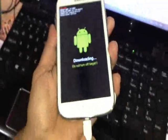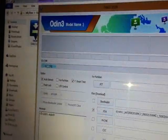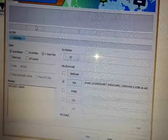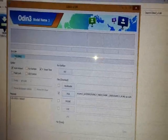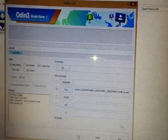Now you need to connect your phone using the data cable to your PC. Once it's connected, you will see the indicator here turns blue. If it turns blue, that means you have successfully installed Samsung KIES on your PC. If that installation is not properly done, it will turn red, so you need to install Samsung KIES first. Now it's blue, so I'll just hit Start.